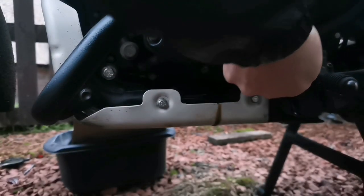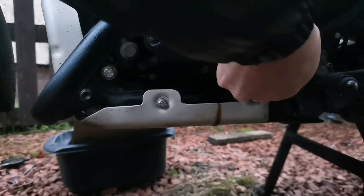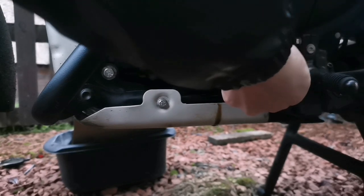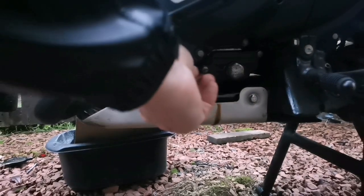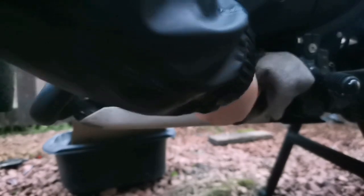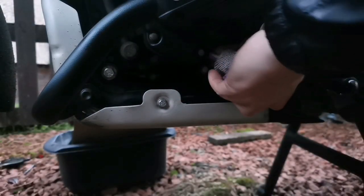It's just to make sure that you never really have any issues with those bolts seizing up. Just don't overdo it with the anti-seize, and also just be careful that you don't over-torque the bolts. It's really easy to over-torque a bolt when it's got anti-seize on it. Yeah, so you need to be super careful. You need to drop probably about 25% on it. Once you get your oil back in there, guys, you want to be checking for leaks. If anywhere's going to leak, it'll come out of this plate for sure.